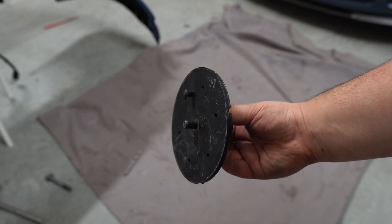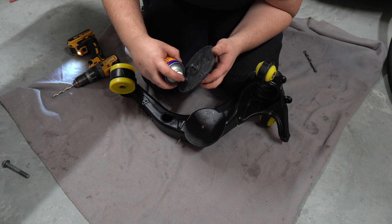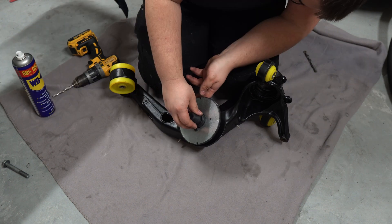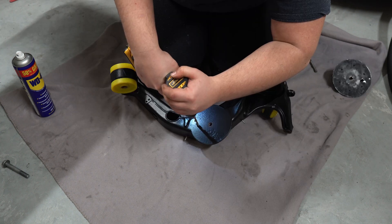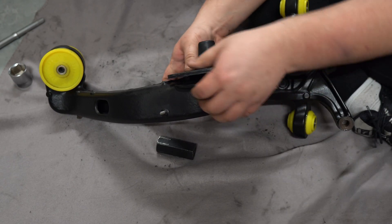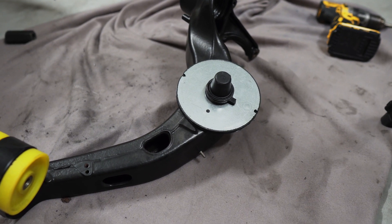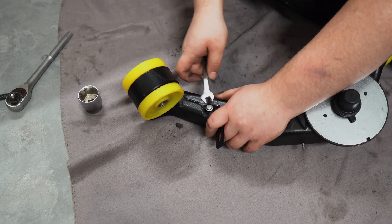In the next step I will prepare the wishbones, starting with the stop buffers that go under the rear spring. If your car is early 2000 you will most likely have the old-style wishbones which use a thread to mount them, so once you buy new buffers you will have to drill additional holes so they can fit properly. Following that I'm installing the brake line holders, and just after that we can take our brackets and try to put them on the new poly bushes.